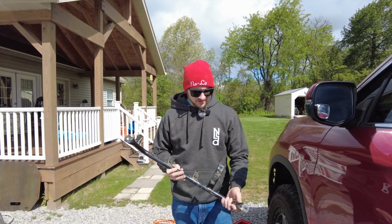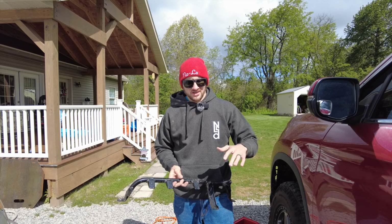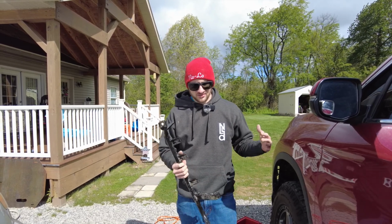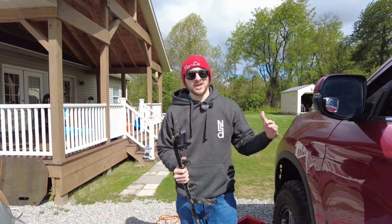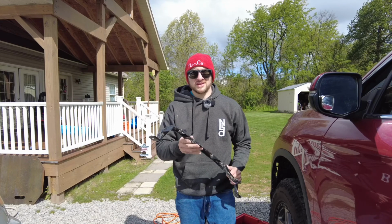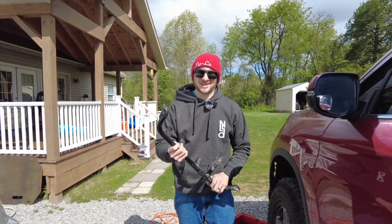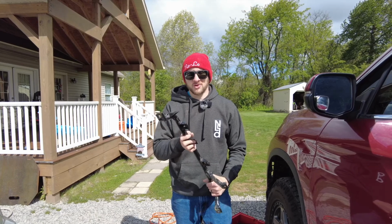Okay, so when you install the Traxda 3.5-inch lift kit on the truck, you have to do a 1-inch subframe drop. So you're dropping the front and rear subframe, and in turn you drop the drive shaft. On the 2017 and up Ridgeline, the bar for the gas tank is part of that. So you end up dropping and spacing this bar down by about 1 inch.